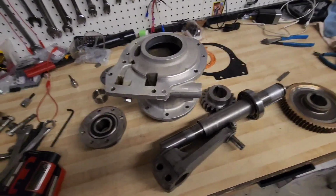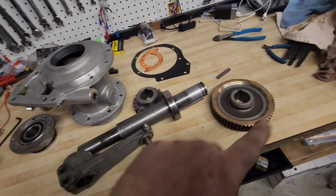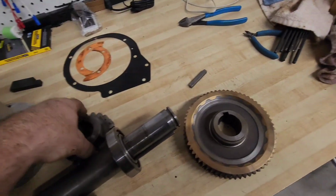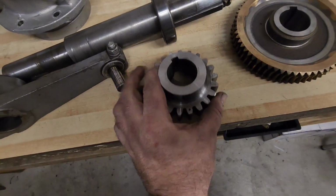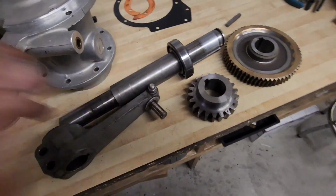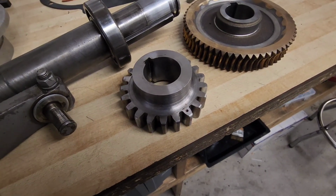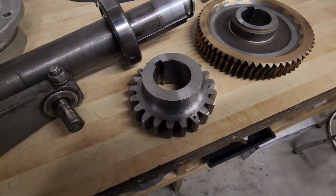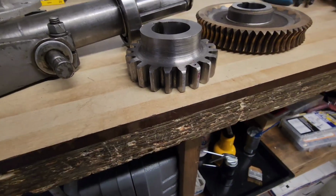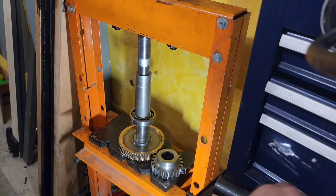So we've got everything cleaned up, smoothed out, ready to go. We have everything that we need. New gear. That spur gear, it's not tapered. The new ones are tapered, but all of their gearboxes are older style, so that non-tapered style should work. I'm also not going to mark the timing tooth on there. It's got a dimple, but I never do these at 0 degrees anyways.